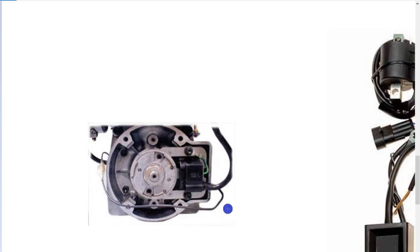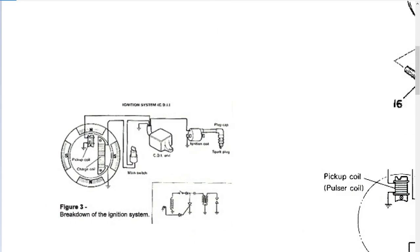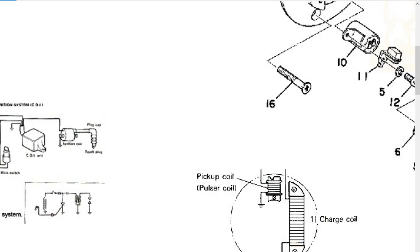Keep in mind that some coils have things like rev limiters built in - like in chainsaws. So if you've got a chainsaw or engine that won't rev, that can be fuel or other reasons, but it can also be a defective rev limiter inside the actual coil, and you won't know until you identify what coil it is and check the test procedures.